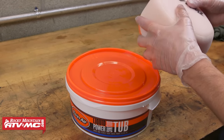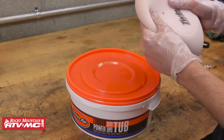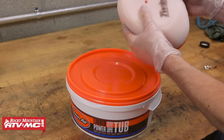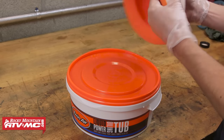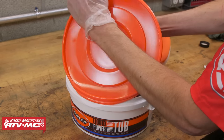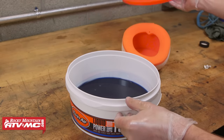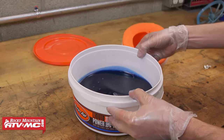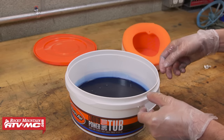After you've cleaned your filter and rinsed it, you're going to let it dry completely before you oil it. Because we had to throw away our other filter, we've got a brand new filter, so it's dry and ready to go. I'm going to use the TwinAir oiling tub — just like the cleaning tub, it has a lid that seals really nice so the oil and solvents in the oil don't evaporate.